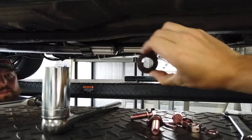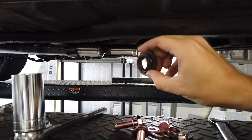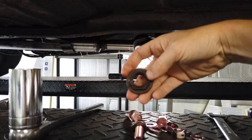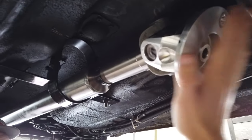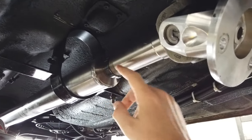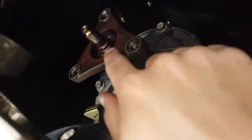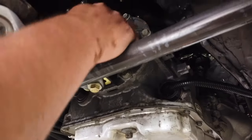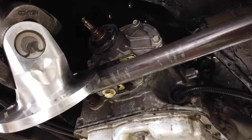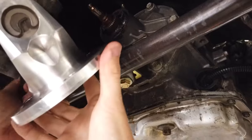Before I got the video started, we ran and got this — it's actually the nut that goes on the back of a 6L80. If you're wondering, that right there is a 30 millimeter nut with a little lock on it. What we have is this little adapter I put on the back of the 6L80 to adapt it to a slip driveshaft style, and that bolts to the little three-bolt flange right there.